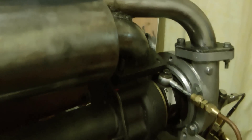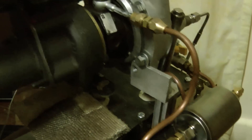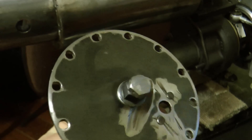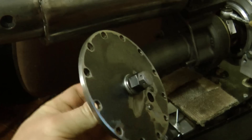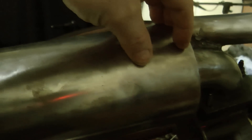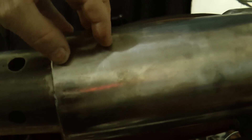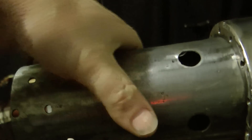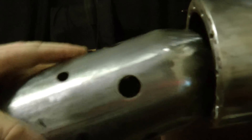I'm going to give you a couple of secrets in my film. One of my secrets — and everybody running on gas should know this — if you see here, that's my gas nozzle. The problem that people have, which you'll see in one of my other videos, is that the gas shoots straight down the combustion chamber and you get the hot spot right there. What you want is the heat or the hot spot here — you want everything combusted in the first half of the chamber. So you've got your primary holes, your secondary holes, which are your sustain holes. The first half of your combustion tube is where your combustion should happen.